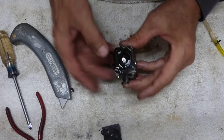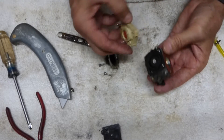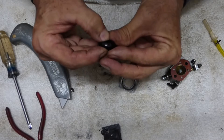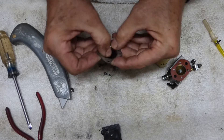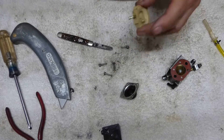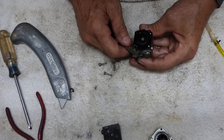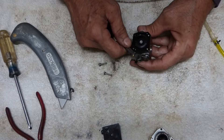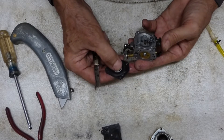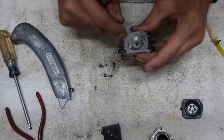Here's the diaphragm — look at that, nice and flexible. This bulb's nice and flexible, no cracks in it. No sense spending his money if I don't need to, and that's super easy to change out if he needs to. Again, be careful around rubber parts with the carb cleaner. This is not in bad shape at all. I'm going to carefully take this off because we've got our needle valve underneath. Nice and clean in there — this is in great shape. Must be that ethanol-free fuel he's using — good testament to that.